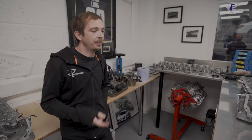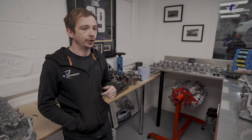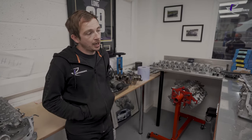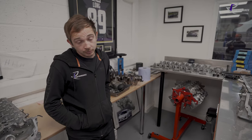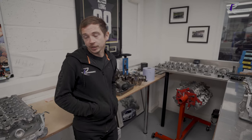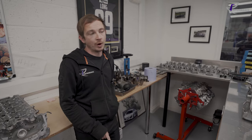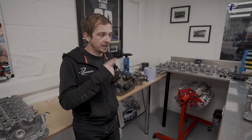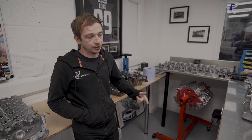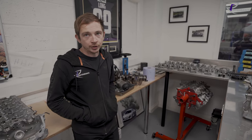Building that picture up, to understand, okay, on the dyno I know I can push this cam timing or that. It might be that you can run it and there's no issue, but I'd rather do the writing down and the working out now than push too hard and find out the wrong way that I've nipped a valve, or I'm in an area the engine doesn't like to be in. I know my squish, my piston protrusion, my piston to valve clearance. So once I've built an engine, I know where I can go.